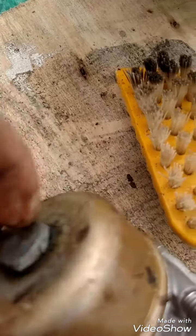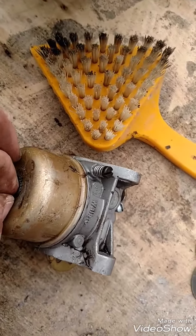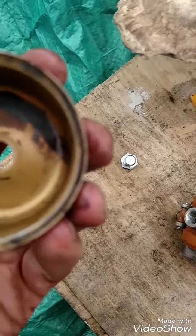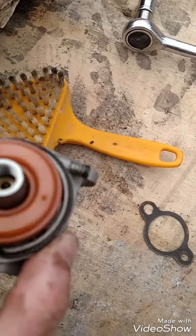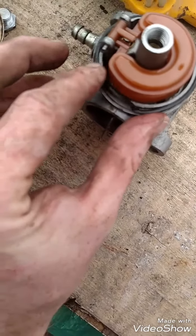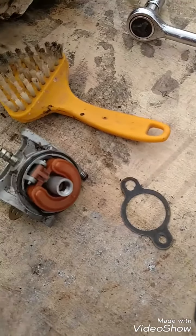I can actually do it by hand. Pull it off — there's a lot of dirt in there. Here's my float, and it looks like the gasket went bad, so I'll need to get a new one. I'll probably try and put it back on and see if it even runs first. If it runs I'll buy a new gasket, or I might just buy a new carb.